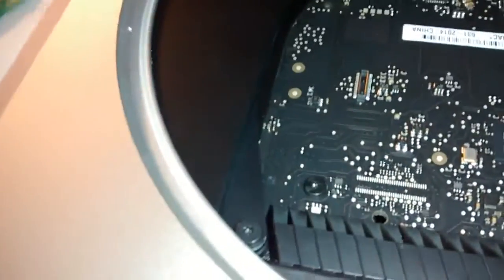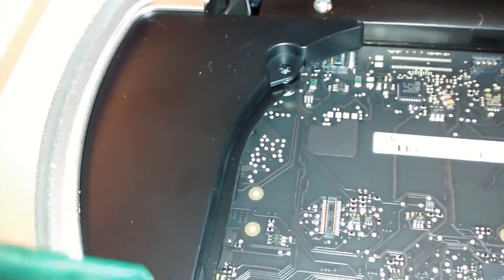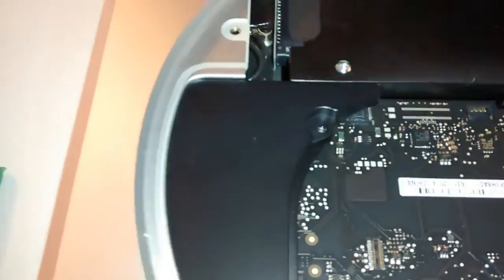Time to remove the fan cowling, which is this black part here. This black area which is like the fan ducting - it directs all the air towards the back of the Mac. There's one screw and it's quite a small one, just there. I'm going to undo that now. That screw is undone. I'm going to lift that out with a pair of tweezers.